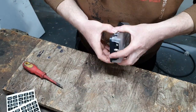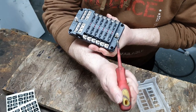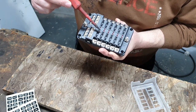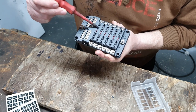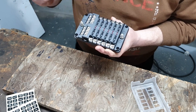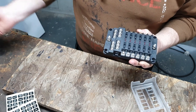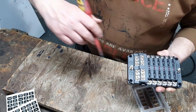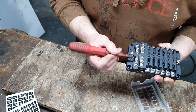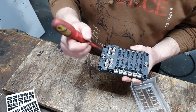So let's have a quick look and pop the top cover off. Two tabs here and here - press them in and the top comes off. Basically we have here a positive supply. That positive supply from the battery puts a positive on each of these terminals. When you insert a fuse, you bridge the link and each of these screws then becomes live. So even with this connected and no fuses in, none of these terminals have any power to them.